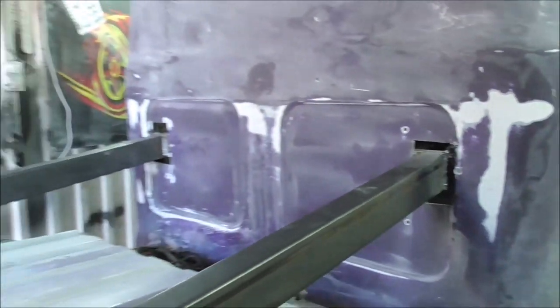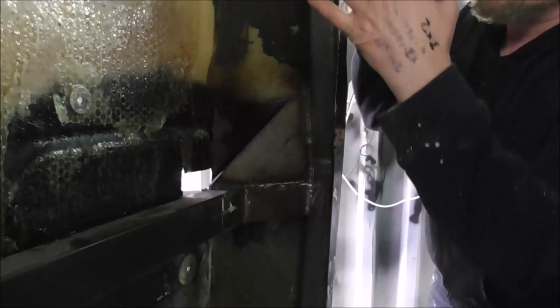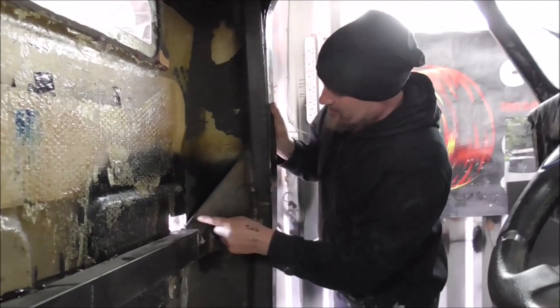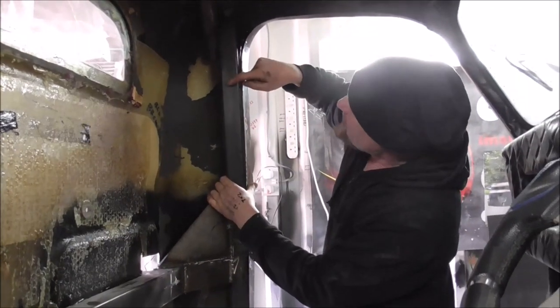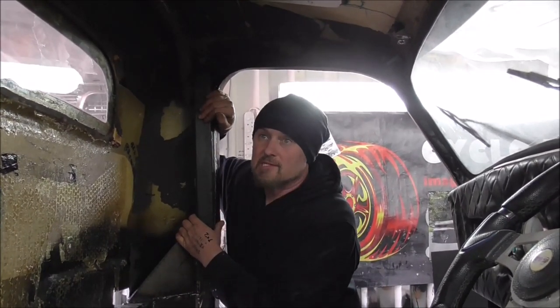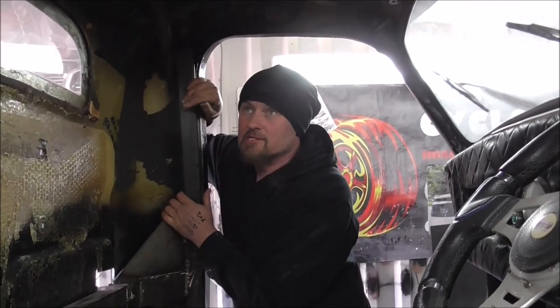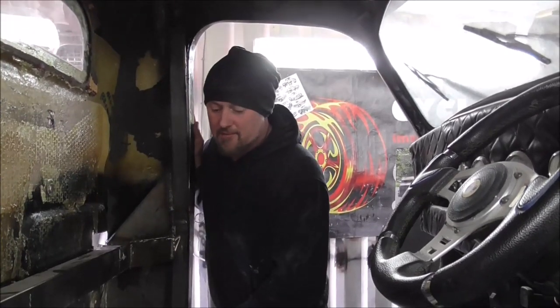And on the inside, we've got these big gusset plates, and they would stop any flex this way and that way. They tie in good, and by the top of this gusset plate, which is absolutely rock solid, we're only going to be, you know, a couple of hundred mil away from where the top mount to the seat belt is, and this piece of heavy duty box section isn't going to bend. So now we've got somewhere for the top and bottom mount for the seat belt.